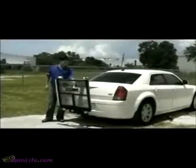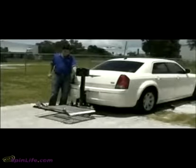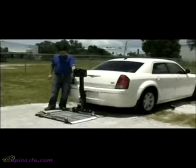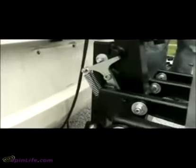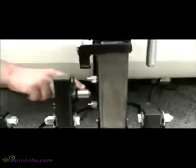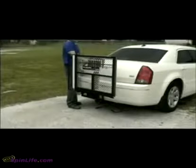Power the lift down to the ground. The platform should unfold smoothly — the end furthest from the bumper will contact the ground first. The lift will pivot on the hitch post, allowing the entire platform to rest evenly on the ground. An important part of this lift is the patented folding mechanism called the J-Cam assembly, which consists of one J-Cam held on by a shoulder bolt, two extension springs, and a stainless steel roller. The cam assembly allows the platform to sense weight and fold accordingly. When raising the lift, continue operation until you hear a ratcheting sound from the motor box, which is a clutch — this sound is normal. Failure to raise the lift completely can cause damage.